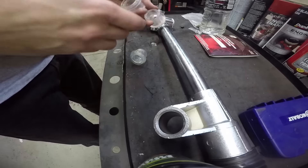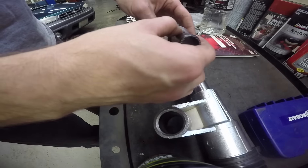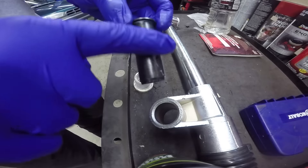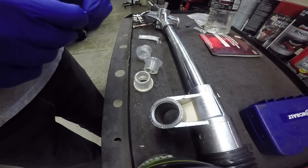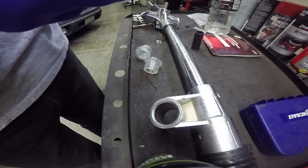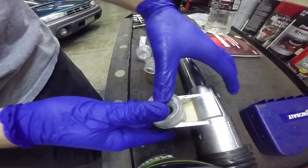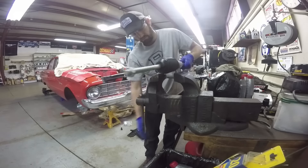Now this is the manual rack and pinion kit — it comes with polyurethane bushings that you need to coat. You'll also get a little squeezy tube of clear grease; you have to grease the inside and the outside. The bushings also come with a black sleeve — it's not really a spacer; it has a butt end on one side and nothing on the other. The butt end goes on the side that goes up against the cross member. You don't need an additional spacer because the sleeve has little teeth on the end that bite into the metal. Getting them in is a challenge — I ended up using a vise to press in the sleeve.